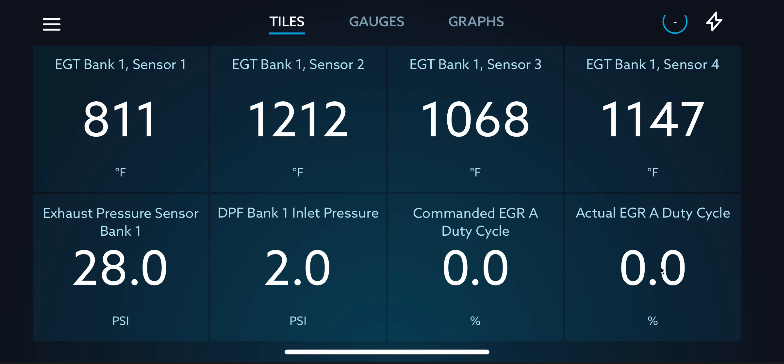This is my first observation of the active regen in my 2020 Ford. I'm hoping that the regen interval remains at 500 miles. Unlike my 19 Ford and 17 Ford, which would go into regen anywhere between 100 and 500 miles — averaging about 280–300 miles — the 19 RAM was very predictable at around 1,100 miles, which I really appreciated because I could plan to be on the highway for a full regeneration. With the 2020 Ford, Ford typically does a regen at 500 miles regardless.